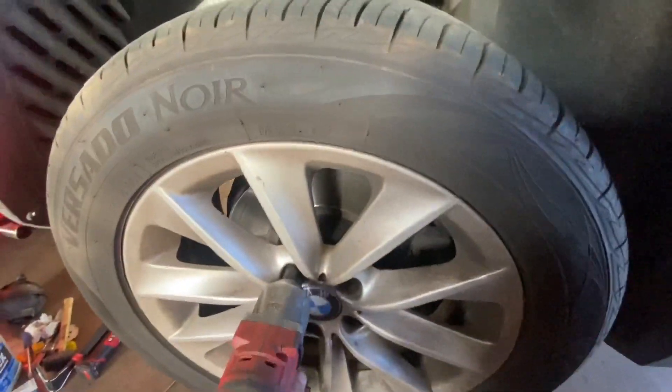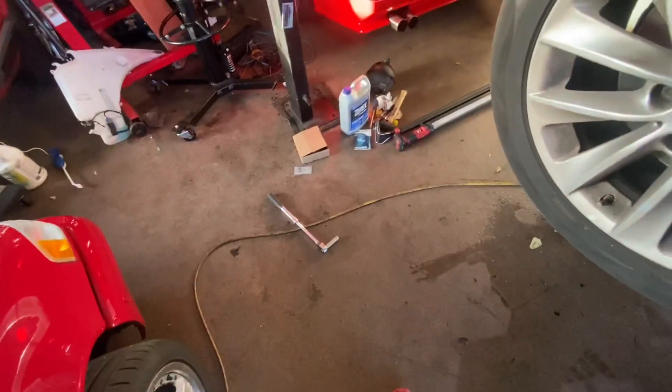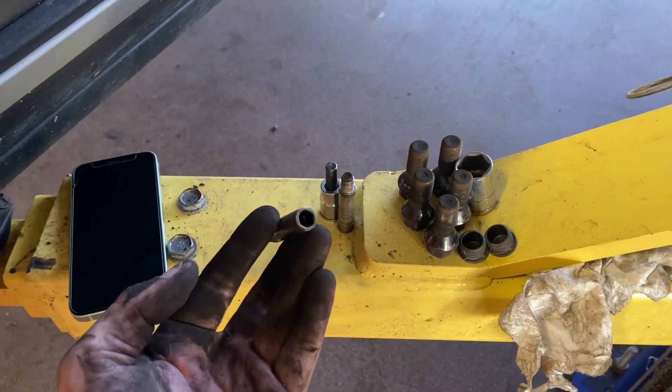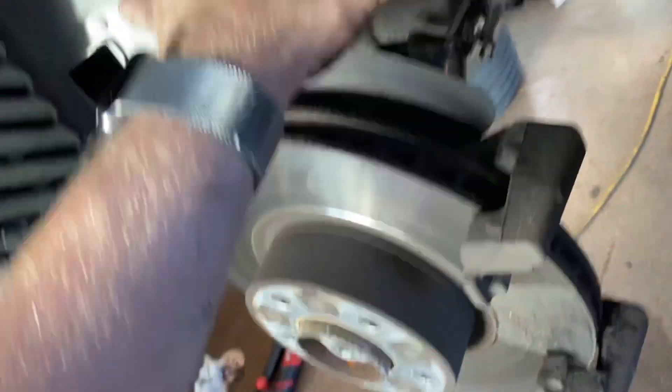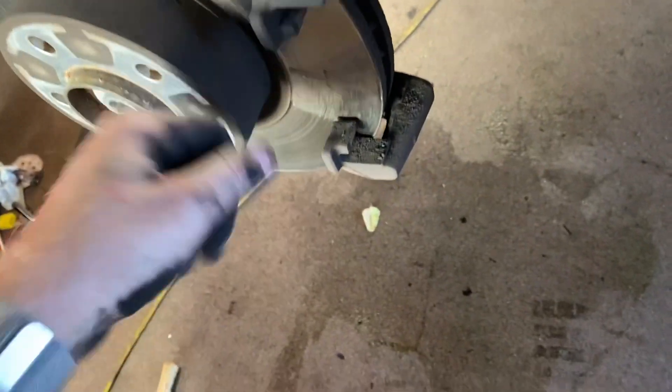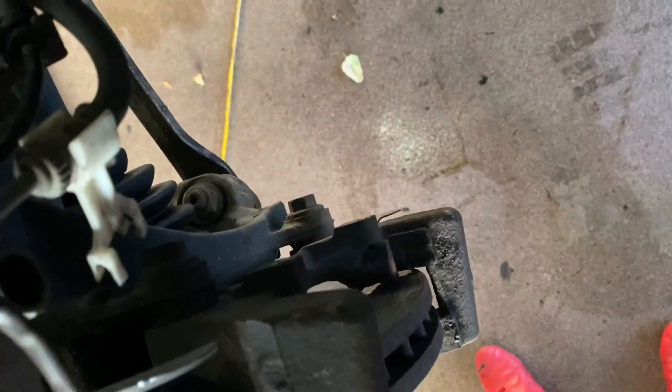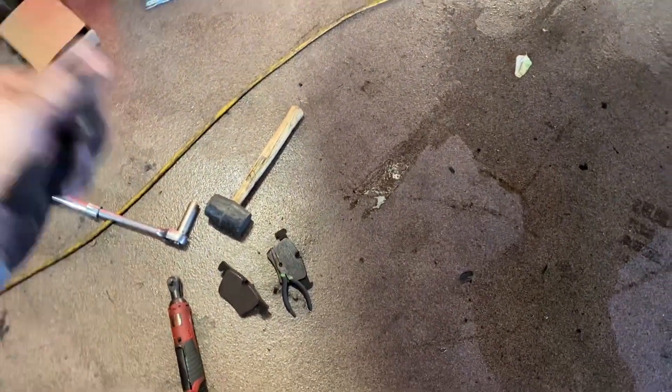Yuck. It must have been Tires Plus — I had to put the thing on the ground and stand on a 20-inch-long wrench to get these off, they were so in there. The only surprise so far is the slide pins are now 8-millimeter hex instead of 7. Got the caliper off. The anti-rattle clip — just pry and pull. Looks like we have a 6-mil retainer on the rotor and looks like 18s on the back bracket. So I'm going to grab my 18, get the bracket off, pull the retainer, get the rotor off and take a look at the hub.